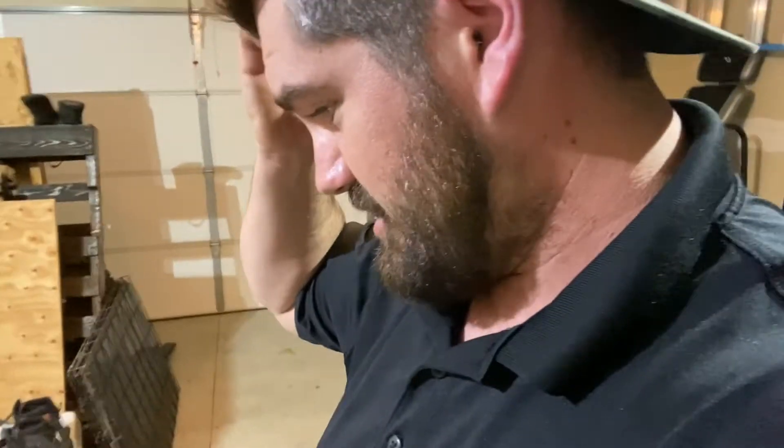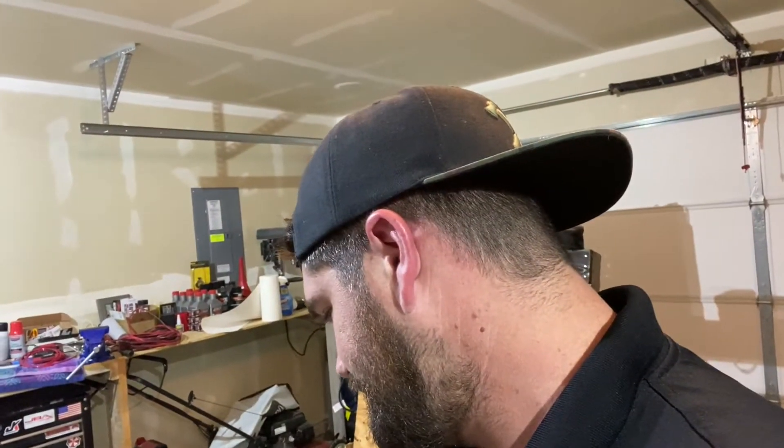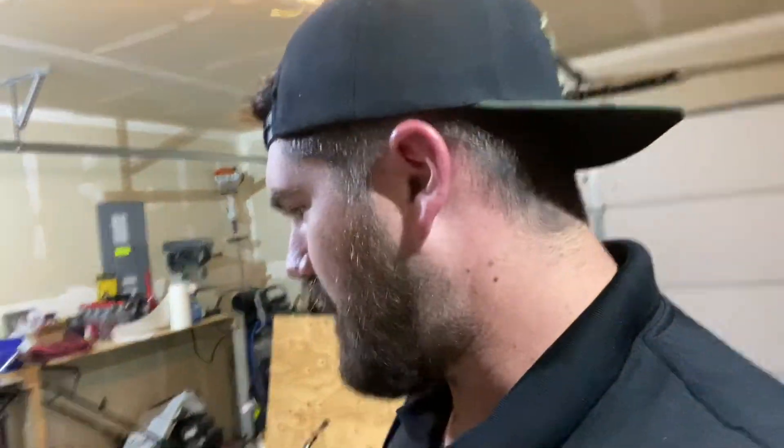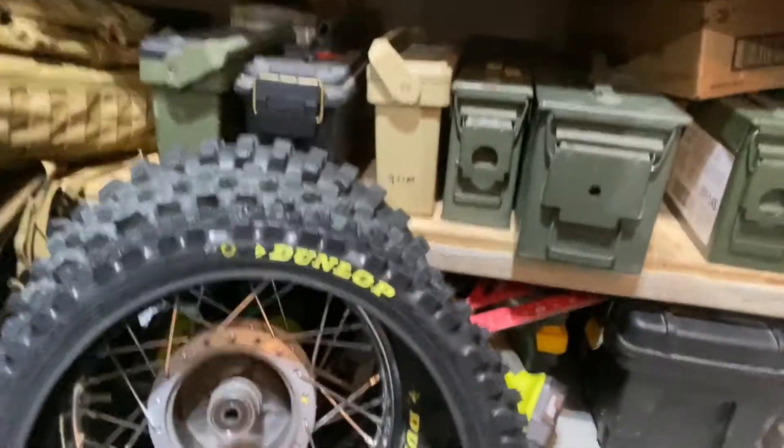Last time I mentioned I was getting BBR stiffened front fork springs and a dampening rod — they're in there and it's real nice, especially for a heavier rider, about 215-220 on a good day. It rides well, I have no complaints. The Dunlops grip up great. Got my old rear tire here and my new front tire ready to roll. Got new fuel — and here's another thing I want to hear from you guys in the comments.